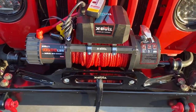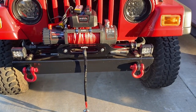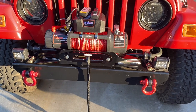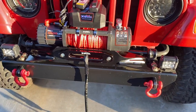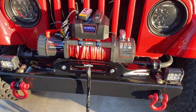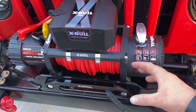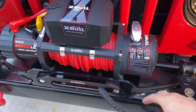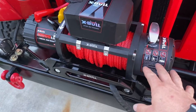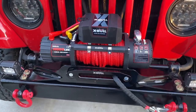As far as the winch, it is kind of noisy — it sounds like it's going to fall apart, but for the most part it's been pretty solid. I do plan on doing a full review on this winch in the future where you'll see it used out in the field. I've also watched videos where you can take the gears and planetary gears off and get some premium grease in there — they apparently don't come well greased from the factory. So re-greasing is an option if you want to quiet it down, which we might cover in another video.